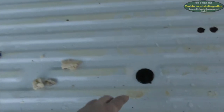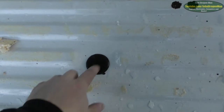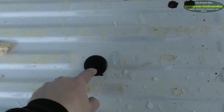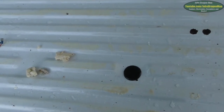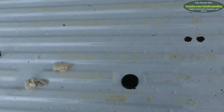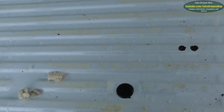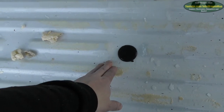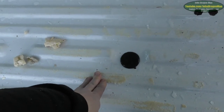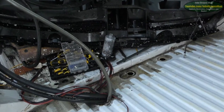So they came up with the idea of getting a tape that winds around and around — this is your centre point in the middle there of your steering wheel. Now the beautiful thing about modern day vehicles is they run a thing called CAN bus, which you hear a lot of people hate, but it's actually a very good thing. CAN bus enables you to control multiple things with just two wires. Very, very cool. Going back to the van.